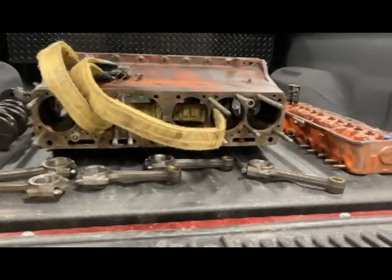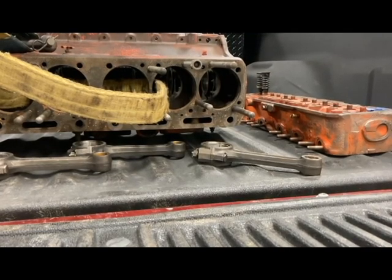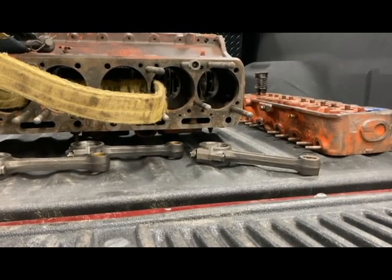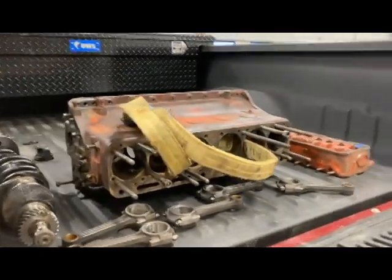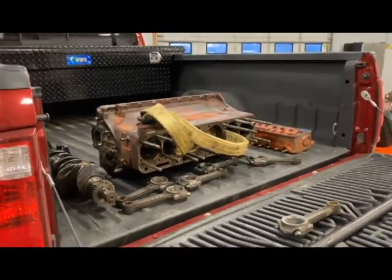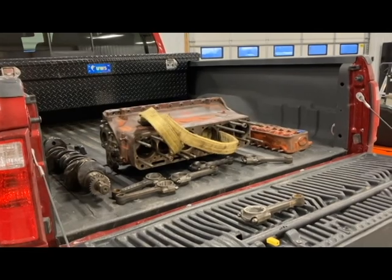Nothing major, but what you've got to watch for is the bottom side where your liner fills in with the ring seals — the O-rings. If it's cracked there, that's where you'll have problems because you'll get a water and oil mixture. The top side will get sealed up with your head gasket, so don't go cheap on your head gaskets — get a good head gasket and you should be fine. Anyway, that's the update on it. Thanks for watching — like, subscribe, share the video, leave a comment below. Until next time.